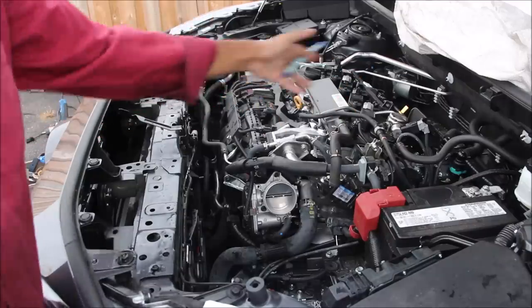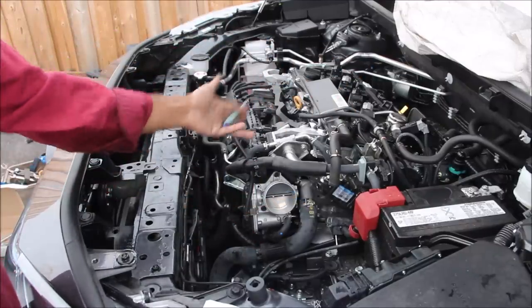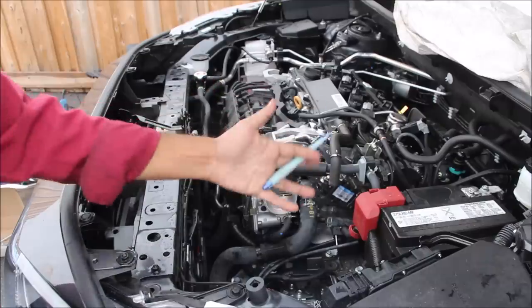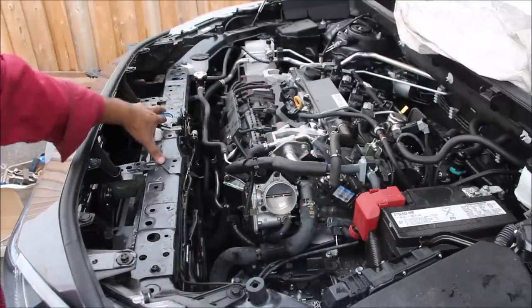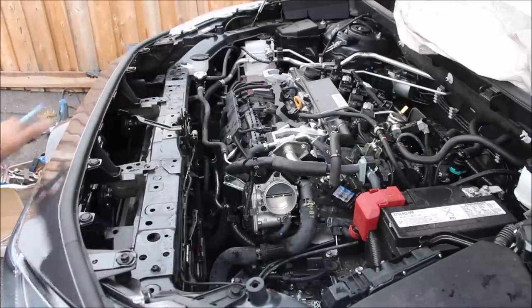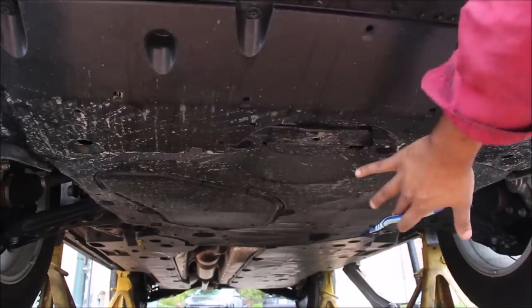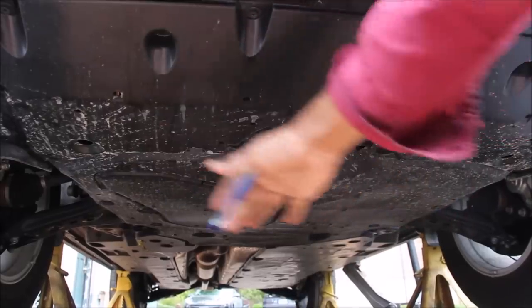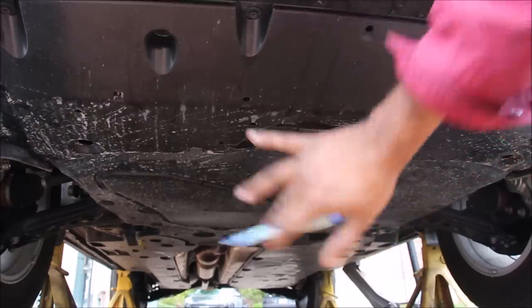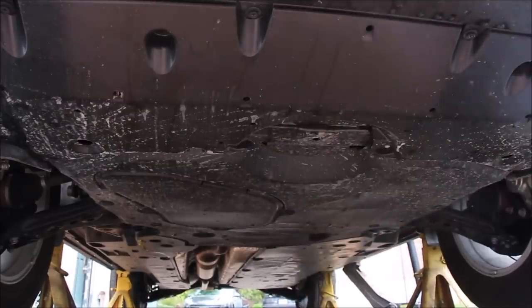Overall this engine seems very spacious and easy to work on in this fairly large engine bay, despite all the plastics and electronics that dominate modern vehicles. The only downside is that to remove the radiator you have to remove the front clip, which means you have to recalibrate all the radar sensors. Underneath the new RAV4, you can see everything is clad with plastic and is fairly flat — that's just to help with aerodynamics and fuel economy, but it also prevents salt water from splashing up on vital components during winter.